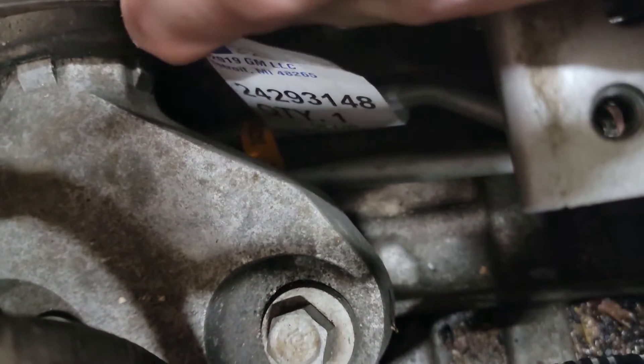All I have to do now is put Humpty Dumpty back together again. It's been sitting here for about a week in this current state because I had no ambition to come out to the garage, and this car is here for a whole slew of other problems. One of the windshield washer sprayers is not working - currently both aren't working because the line broke somewhere. It's also got a sticking caliper on the front, and a rear bearing on the passenger side that is grinding like an old TV set - it sounds like there's rocks inside of it.